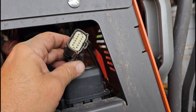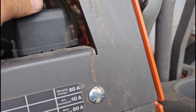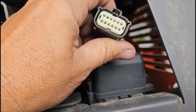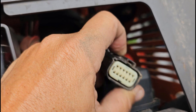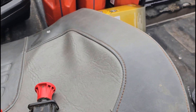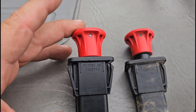Here's the part in the mower, here's the PTO switch that came out. It literally just pulls right out of this socket. There's a little detent - you see that little detent right there? That's this part right here. You just squeeze that and with your other hand pull straight out.